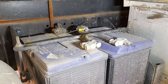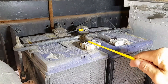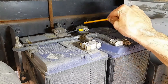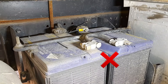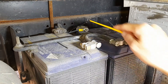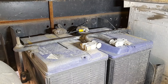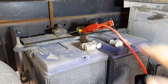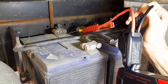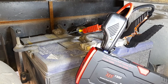Here is a 24 volt system. These two terminals are connected together, giving 24 volts at both sets of terminals. Since our device is only 12 volts, it would be risky to connect it across the full 24 volts. So I'm going to connect my 12 volt jump-starter — positive to positive, negative to negative — but only on one battery. The device is flashing green.